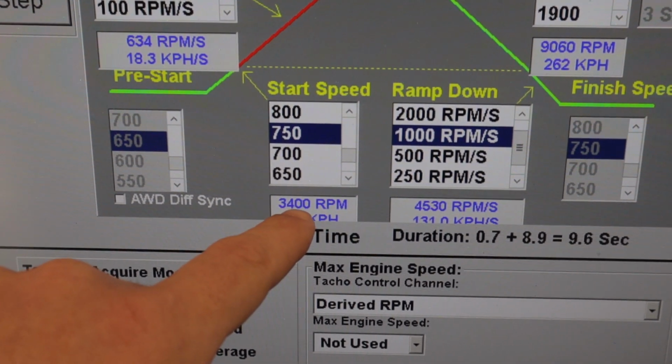I haven't had an opportunity to put the same car on 2 Mainline dynos, but considering how they do everything that they do, I would say that they're going to be pretty much spot on with one another. I think when people ask this question, what they're really asking is how does it compare to a Dynojet? I tune a group of cars for a class where after the race is over, they actually have to put the car on a Dynojet at the track, and if they make over a certain horsepower number, then they are disqualified. So we know what number we have to make on my Mainline dyno in order to not get disqualified on the Dynojet, and with that being said, the Dynojet does read higher.